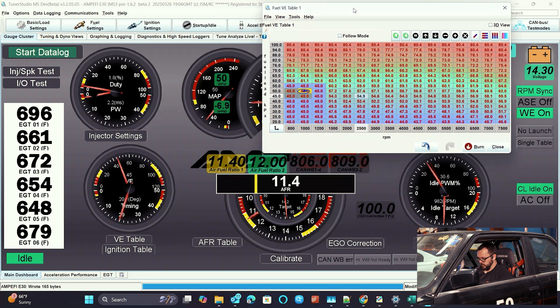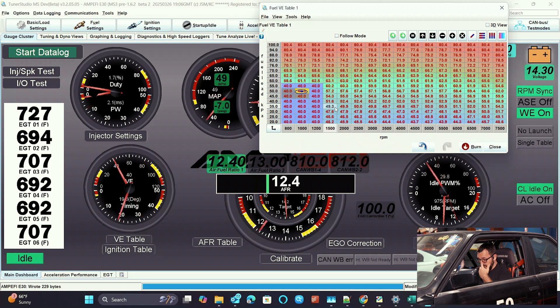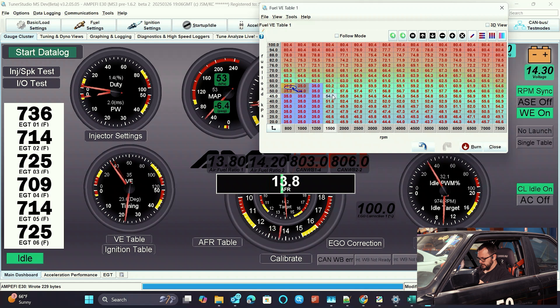When we're doing this testing and just moving values around to try and clean things up, sometimes it's best to just go ahead and use a big block of fuel around idle when you're basically guessing at what the air fuel ratio should be. This is what I've found to be the fastest way to get this done.